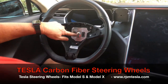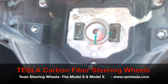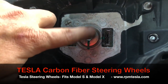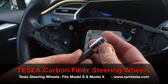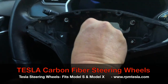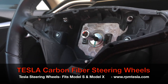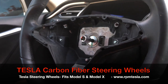The next thing to point out is this green line. This is what's installed on here by Tesla when they torque this down to the settings that they build when they build the vehicle. This lineup guideline tells you where to start and end this nut when we pull it off. This is our 10 millimeter Allen wrench hex that goes right in there. All we're going to do now is use a ratchet of any kind or size — any size socket ratchet will work.